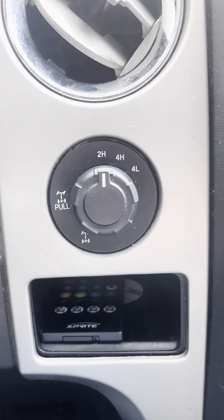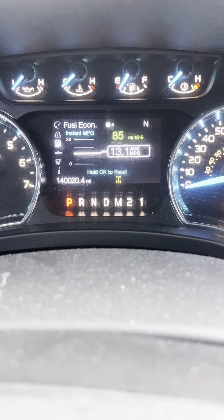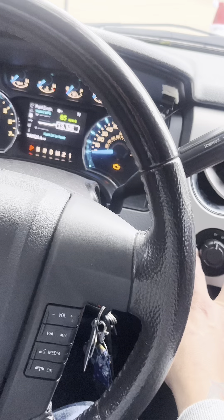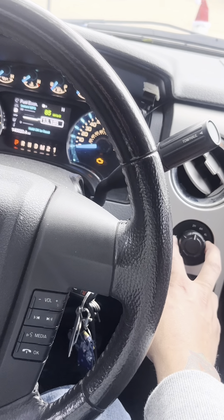As you can see, with it just like this, my differential light is on. But if you push it just barely in, it goes off — and out, it's on again. Anytime I went under 20 miles an hour, I had to drive with one hand holding that down so it wouldn't lock up, the other hand steering. As soon as I got straight to go past 20, I'd take my hand off and it'd be fine, but as soon as I went below 20...